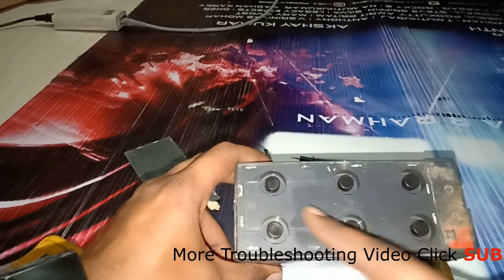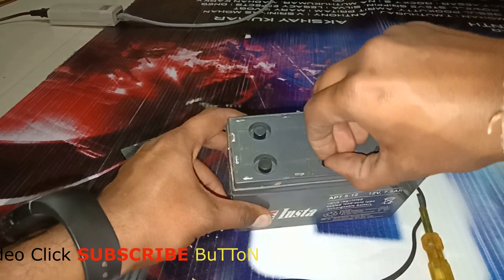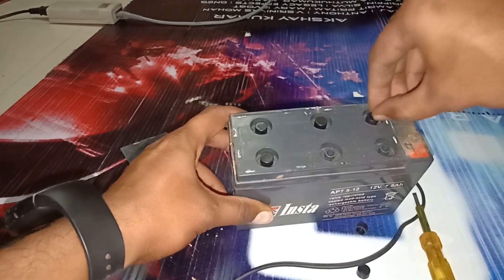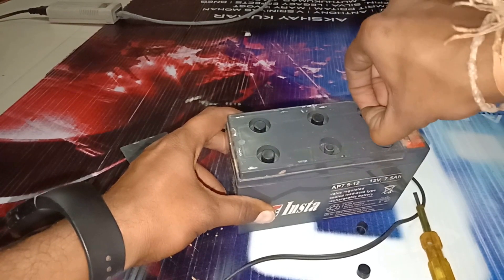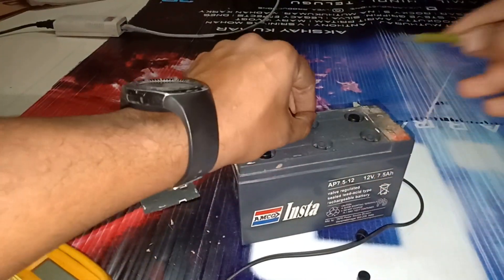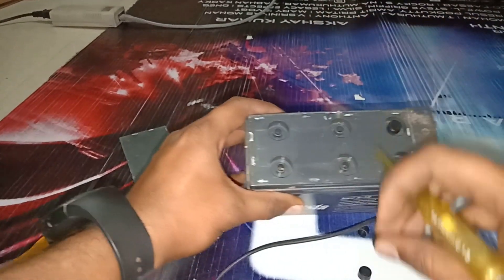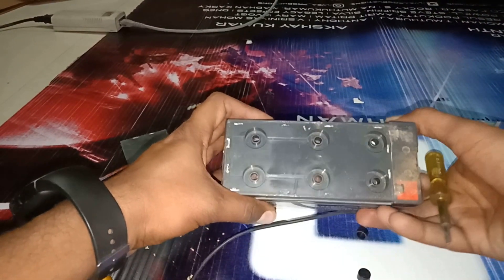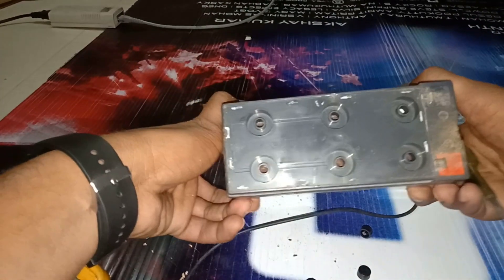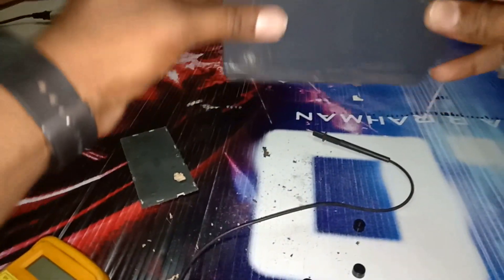You can see there are six cells in this battery. I will check each and every cell to see if the distilled water in the battery is available or not. I will remove all the caps of the cells. Use gloves because in a working battery, some chemical reactions happen inside — that time you could injure your fingers. My dead battery has totally no water inside — it's distilled water, not regular water. Also, one cell is a little bit corroded.